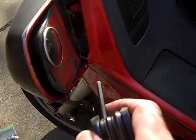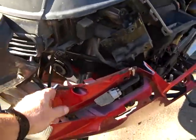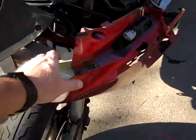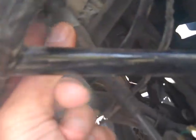I have to take the mirrors off, and as you can see, I've taken the whole front cowling loose — you can see it's hanging down. I didn't want to disconnect everything or take it completely apart, but I'm going to get up and reach in. Right here where my fingers are, there's the speedometer cable. I'm going to unscrew that — it's got a lot of threads — and then pull the whole thing out through the guide.